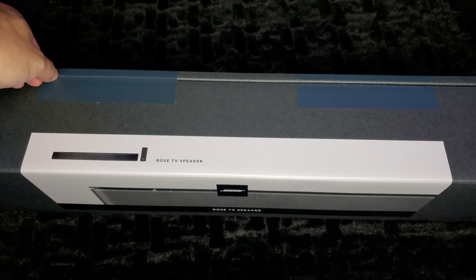Up top is actually my TV's one connect box — I put this here so you can see how to connect everything. We have three options of connection: HDMI ARC, good old-fashioned optical which Bose provides a cable for, and of course Bluetooth. I recommend using HDMI ARC as it provides the best sound quality. On your TV you'll have to decide whether you want optical out or HDMI ARC out, and you'll also have Bluetooth available at any time.